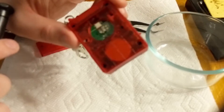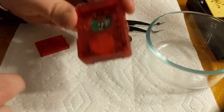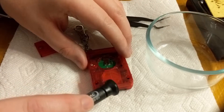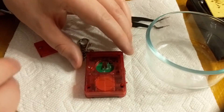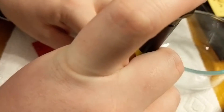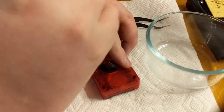Fun fact: the inside of this device is green, but the inside of the purple device is blue. I don't know if that was done to make them more or less visible through the translucency, but it's interesting — the English 20th devices were the same way, some had blue and some had green depending on the version. Next we need to take out the four screws in the corners. I'm using a very small flathead screwdriver. JIS screwdrivers are also good. I would not recommend Phillips heads — they tend to strip these types of screws.